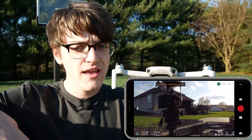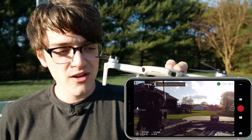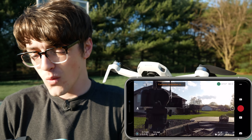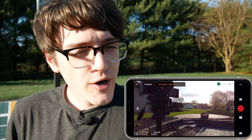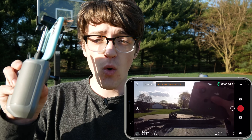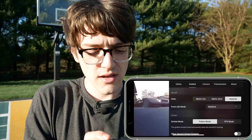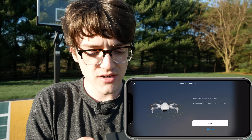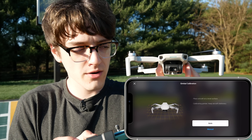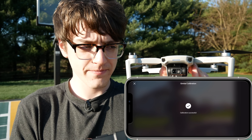I do find it a bit weird that it was still trying to move after the first couple of attempts, kind of seems weird that it was trying to calibrate even after the gimbal protector was known to be on. If you go and remove your gimbal protector and the gimbal doesn't automatically calibrate, all you've got to do is go on your app, click the three dots in the top right-hand corner, click on Control, scroll down until you find Gimbal Calibration, keep your drone on a flat surface or hold it really still, and press Auto. Once it is completed, you're all set.